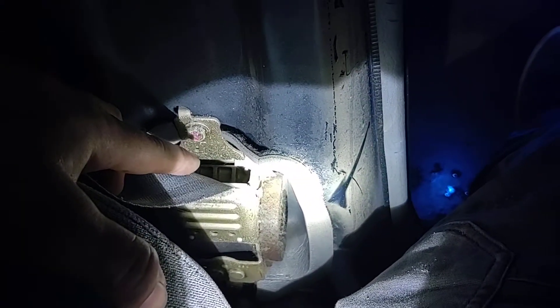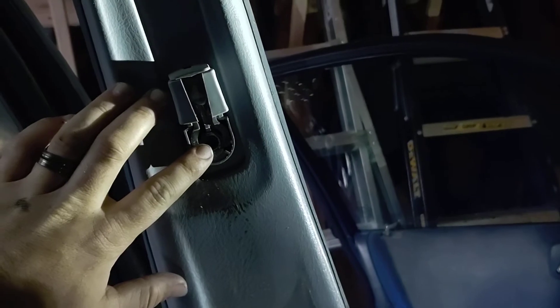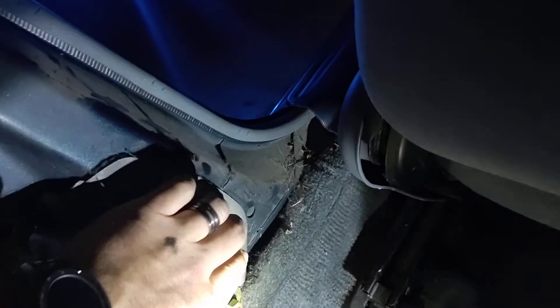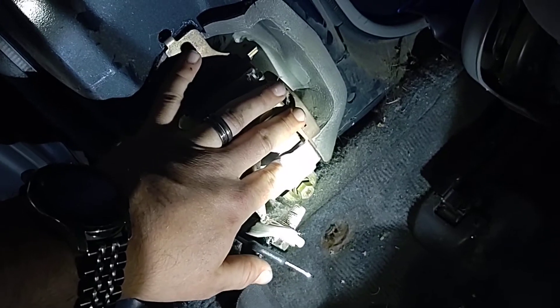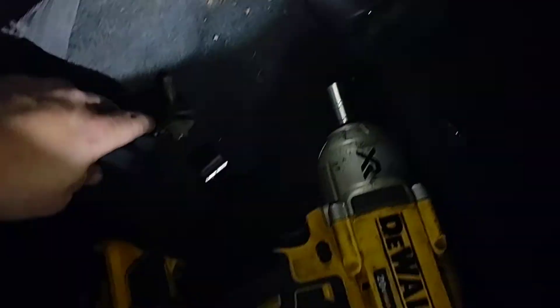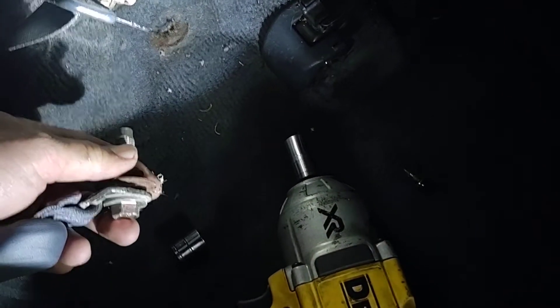Your bolt at the bottom of the belt is down there. You're gonna have access to the bolts that hold in the seat belt here. We've got a 14mm bolt up here at the bottom of this assembly, another 14mm bolt, and a 10mm bolt up here. Down here on the ground there's a little cover — you just pry it up and pull back the piece of rubber — and that's a 14mm as well. I found it a whole lot easier to do this with an impact, because with seat belts these bolts are kind of long and fully threaded, so it's just a lot easier to pop them off with that.